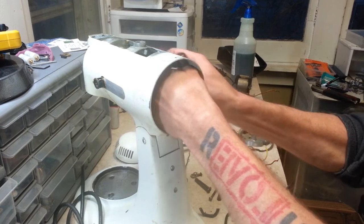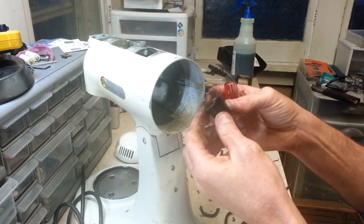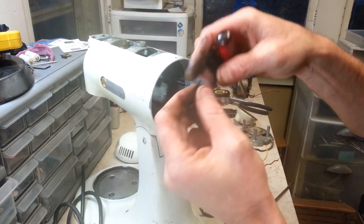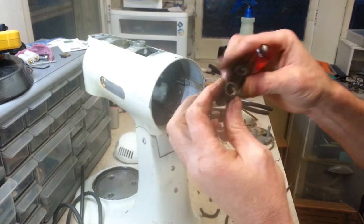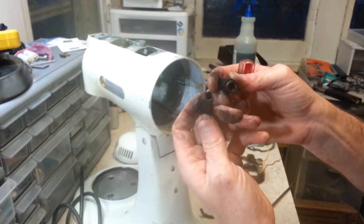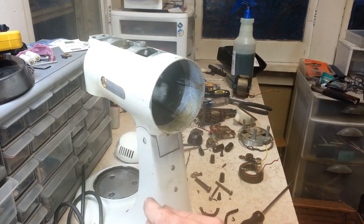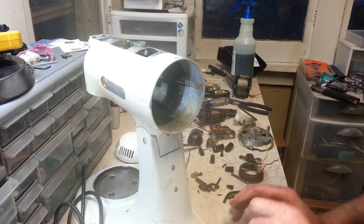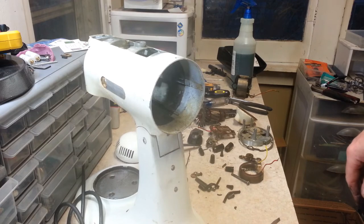Now take our brush holders out. Now this brush holder's pieces just came out. This is like the shoulder on it. The shoulder is completely gone on it, but I think we got another one we can replace that with. So these, of course, have to be cleaned up. They're all carboned up. All right. I think I need to do something with all these parts here, get them out of the way before I can go any further on this. So I'll be right back.